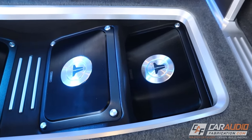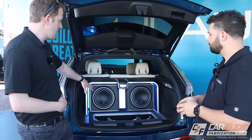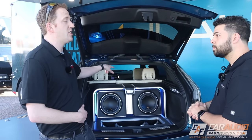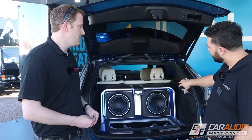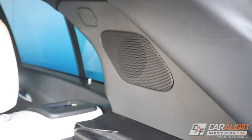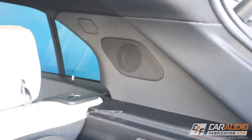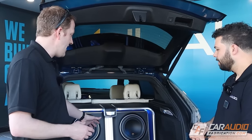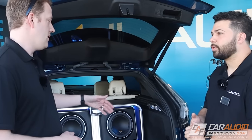You've got to have that extra power on the mid-base. So the 6-channel over on this side here is going to be your two front tweeters, your two front mid-range, but also your two rear speakers. We have a set of C2 350X coaxial 3.5-inch drivers in the surround rear pillars, and that's just used for a little rear fill that can help to widen the stage. You also have the two VX600-1Is in the middle there, one on each subwoofer, correct? That's correct.